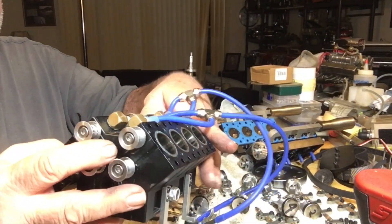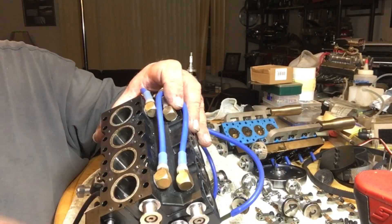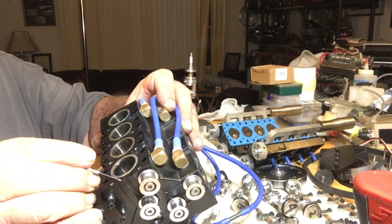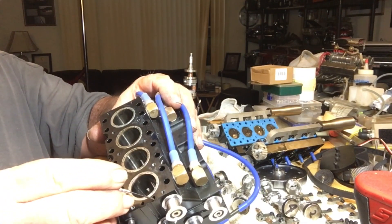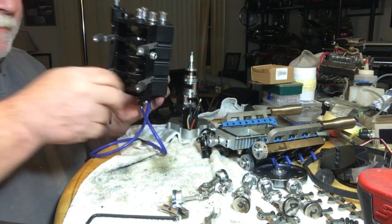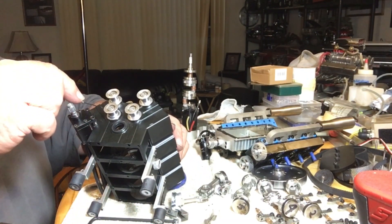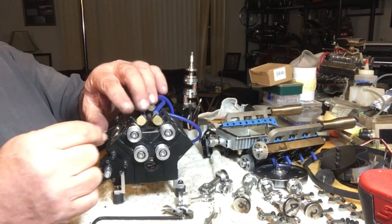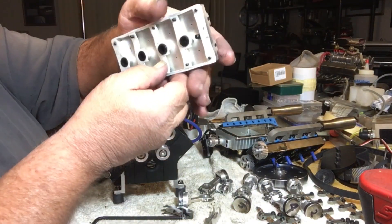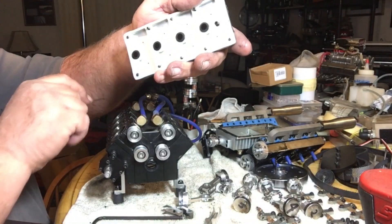Now these are the oiling routes I was telling you guys about. If you look on the block itself — let me get a screwdriver here — you're going to see there are two little holes here. Here's how it oiled itself: they move the oil pan out of the way, it comes up through a cavity through these two holes on the very bottom of the block, rolls up into the cylinder head, goes beyond the cylinder head, and then there's a cavity inside the valve cover up here. It lets oil come through these tiny little holes right here to lubricate your roller rockers.